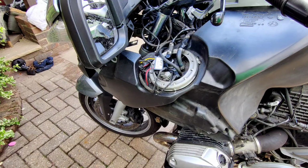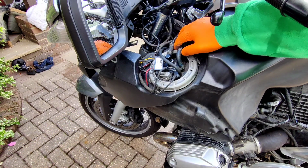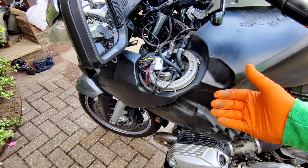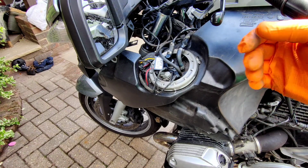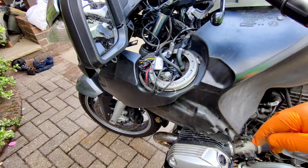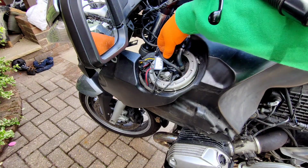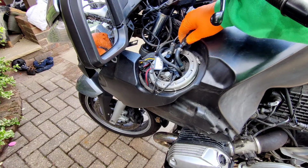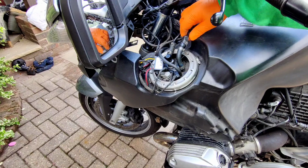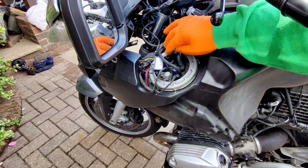That's the fuel pump on the other side. Now, it's got quick release fixings, which is really, again, really handy. Because on most bikes, the fuel pump and connections are underneath the tank, you take the pipe off and you get petrol pouring out, or even a dribble. They're supposed to have self-closing valves, but this BMW has a quick disconnect. You press the button and there we go. There's the fuel pipe apart and one drop of fuel, that's it.